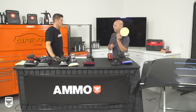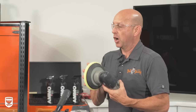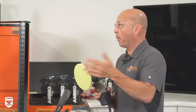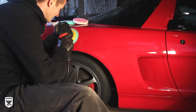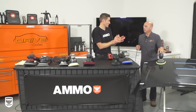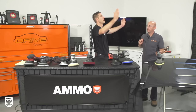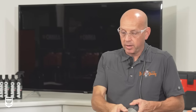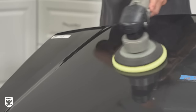The random orbital is lightweight and very versatile — easy to put on three-inch, five-inch, or six-inch backing plates. You can compound, polish, apply wax and remove wax with it, so they're very versatile. When the industry made the leap from rotary to random orbit, the gap was just phenomenal — it changed the industry. Technology has been focused on the random orbital or dual action machines. The average person can pick one up, turn it on, and easily control it.